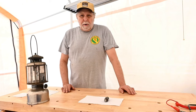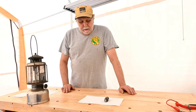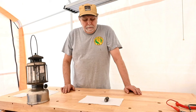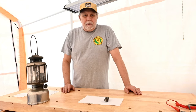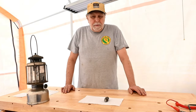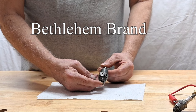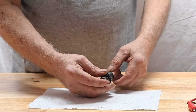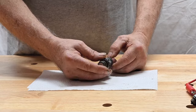We're back to talk about vintage spark plugs — how they evolved and the really super interesting history behind them. The first one was manufactured in 1860 but it was never patented. Then in 1901, the Robert Bosch Corporation, which had a think tank, developed a high-tension magneto and a spark plug both, and put them on the market in 1903. This spark plug here was made right around the turn of the century and has a lot of unusual features. The insulator is made out of mica, which is a mineral that can withstand a lot of heat, is easy to machine and form, and doesn't conduct electricity.